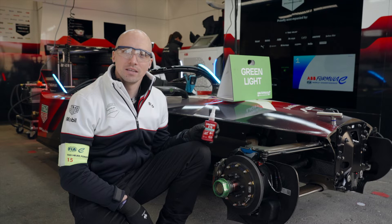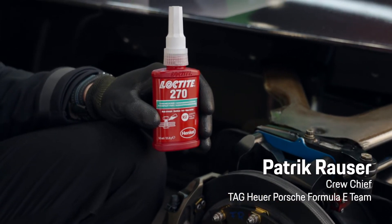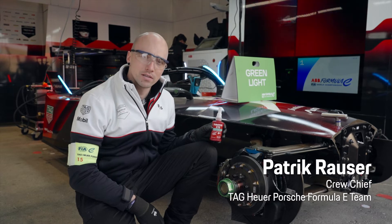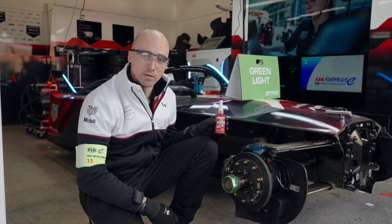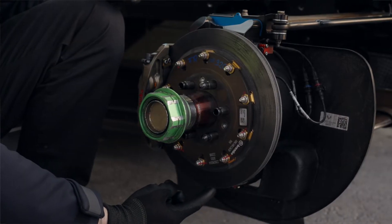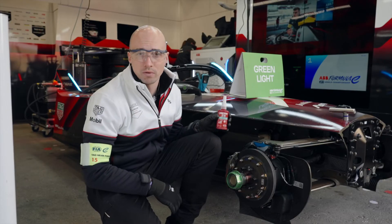Patrick will show us some screws on the car that should never come loose during a race. Yes Martin, the 270 we use on components where we expect high vibrations and great stress, like the upright which we can see here. We use it especially on the big bolts down here to keep the entire upright in position on the wishbones.